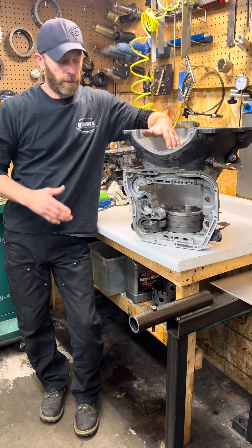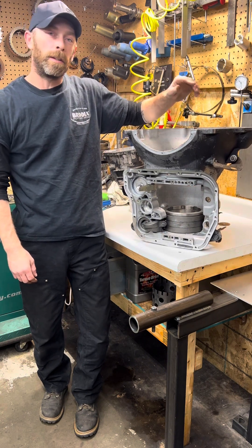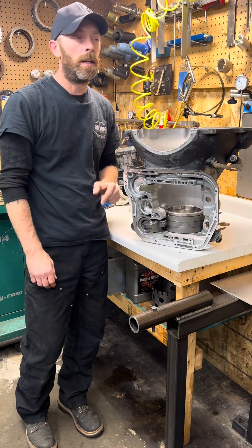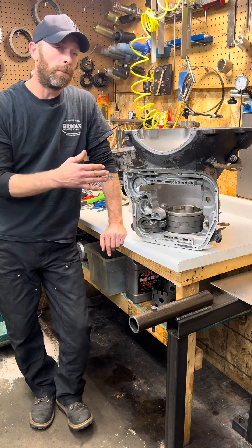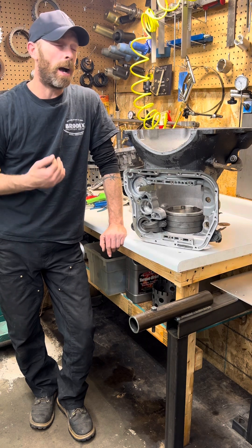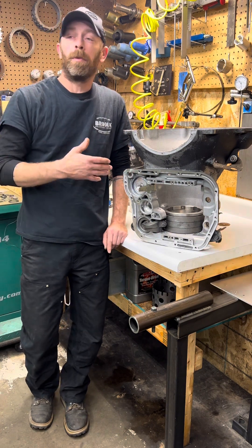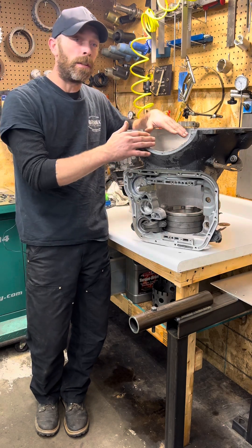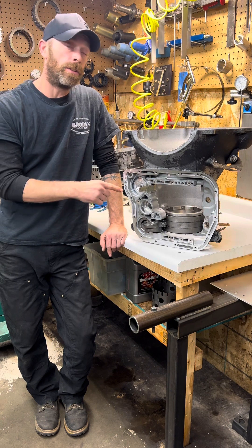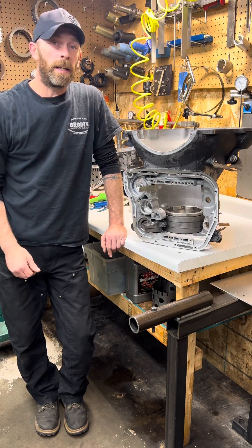Now at this point there's a snap ring, and there are two different ways to do this. The gear train can be set in — you can put the direct, forward, and the pump in and assemble the front of the unit — or we can flip this case upside down and put all of the overdrive components on first. Some guys don't like to install the overdrive first because of the risk of misalignment and gear train problems. However, I find it easier this way because we still have to deal with end play. On a rear-drive Chrysler, you cannot check end play without the overdrive assembly on the transmission, and that's why I do it in this manner rather than building the front first and then adding the overdrive.